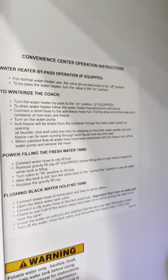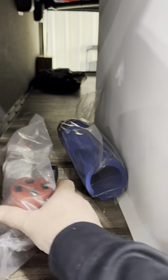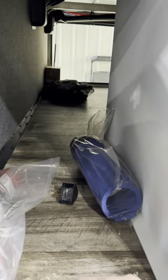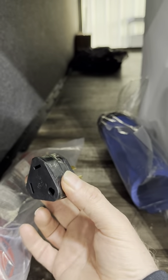There's a light above it, and if you get hung up on any of this stuff you can call me, or there are instructions here on this docking center. This operates on 50 amps — you'll need 50 amps to run everything at once. Otherwise, if you don't have 50 amps, you can use this cord and you're limited to one AC, but everything else should be fine. If you need to plug it in at home, no AC and no microwave, but everything else should be just fine.